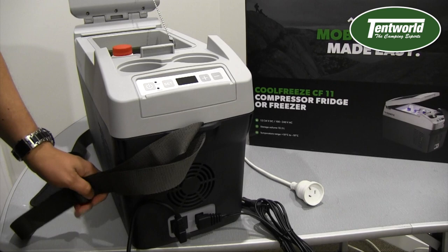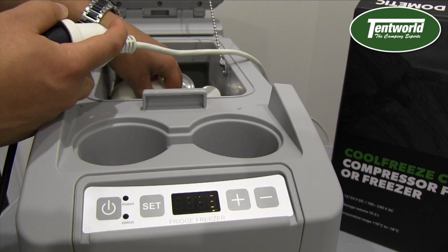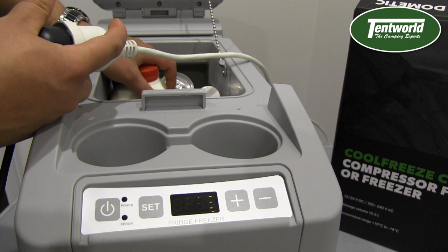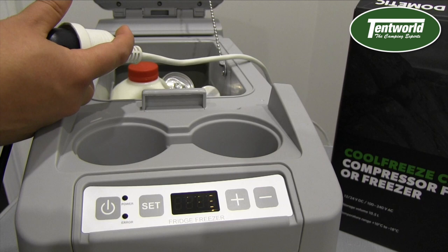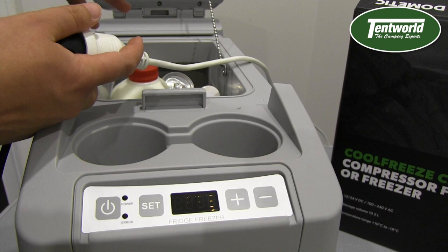Let's have a look at the operation and the control panel. When you keep the fridge full with solids, that's basically storing energy within the fridge. If it's full of air it's very difficult to keep air cold — if you open the lid with only one or two things in there you lose all that cool quickly. The best thing is to fill it with water bottles or whatever you have. Keeping it full makes the fridge run most efficiently and reduces the number of cycles it needs.